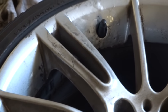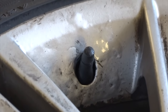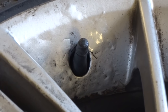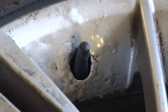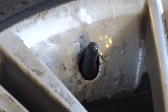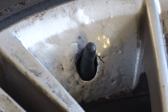They are far cleaner than they were before. If I zoom in on this, for example around the valve, you can see a lot of blistering there — a lot of that paint is going to come back off. The reason it's blistering is around the valve cap the lacquer has started to peel away, where it hasn't been painted as well, being from factory paint. Factory wheels are never painted as well as you'd get from a professional refurb. Basically that has just allowed a little bit of moisture to get in underneath, and that's going to cause corrosion from underneath.